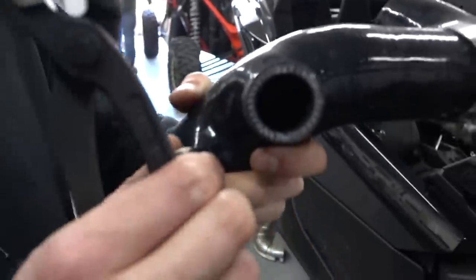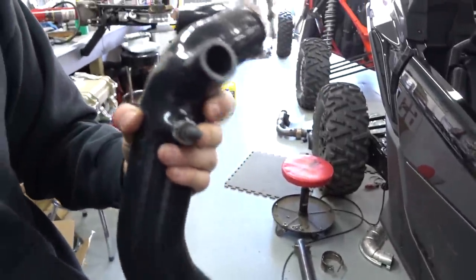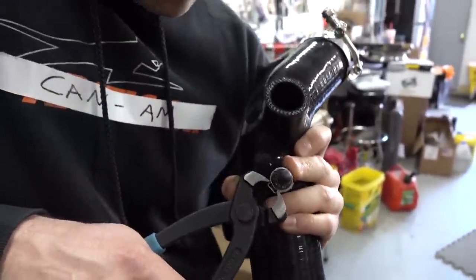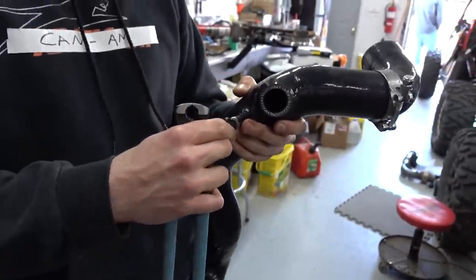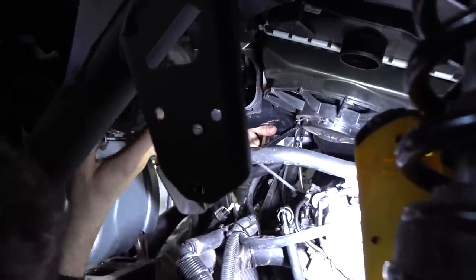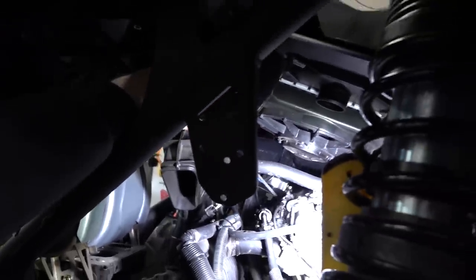This is testament to the quality of the unit — T-bolt clamps on the intercooler and throttle body, and an Oetiker clamp on the block-off. Rick's got the T-bolts adjusted where he wants them and is trying to squeeze the whole assembly in from the passenger side. One other thing: there's an adapter that goes onto the intake manifold on this little port in the back — a T-30 — which is your boost reference for the BOV. We'll get that on after the charge tube goes on. Everything will look good and neat.